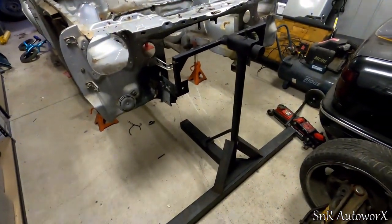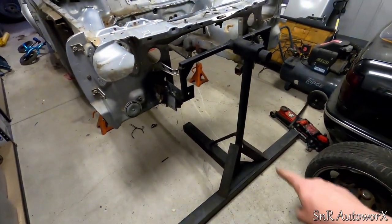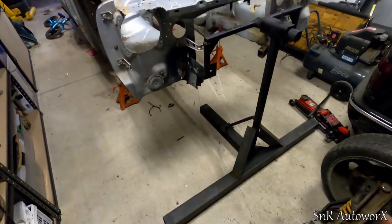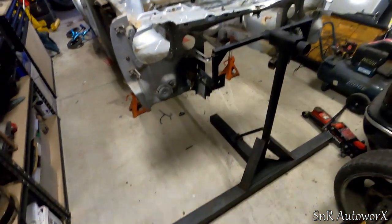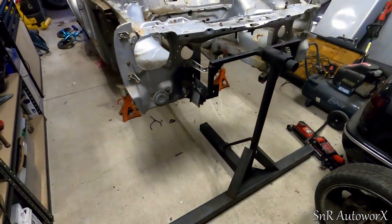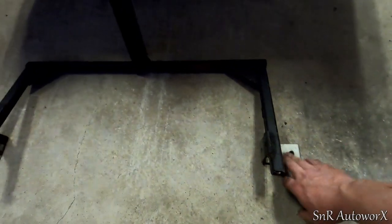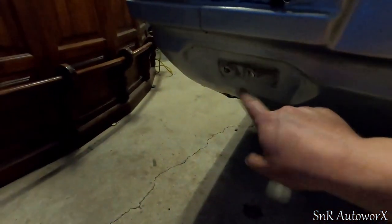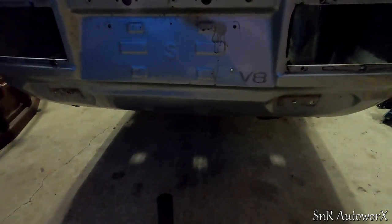I've got it on the rotisserie at the front end anyway. I've got this cross part that holds it up. I've got some wheels coming in the mail — I'm going to put the rotisserie on wheels so it's easier to move the car in and out and around in the garage. But for now I'm just putting it on the rotisserie so I can start doing work under the car. At the back, the bolts go here on either side and where the back bar goes just here — that's where it bolts, with two bolts on either side. I'll get that on and then we can lift it up and put the other part of the rotisserie on.